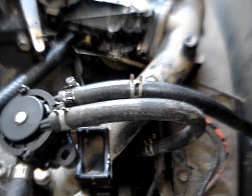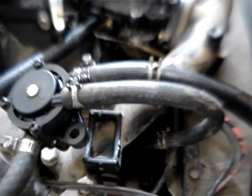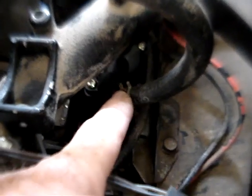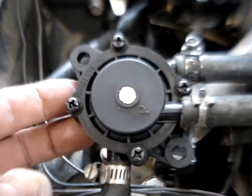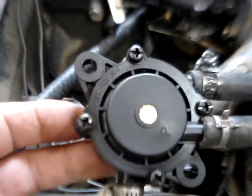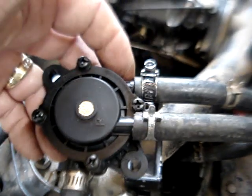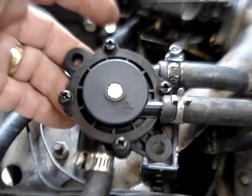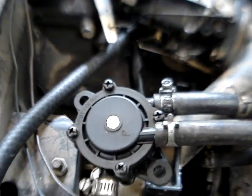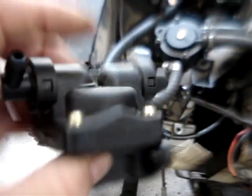All you have to do to convert these over, without drilling any holes in the crankcase, intake manifold, or anywhere else to get a vacuum source, is to use your old mechanical fuel pump that's shot. Just gut it out so it's a hollow cavity, put it back together, reinstall it, and run a vacuum hose out to your pulse pump. This is just an Amazon pump — I'll put the pump number in the description. The biggest thing is to get one with large enough fittings for your 5/16 hoses. You can get rid of these failing Chinese pumps and the non-existent high-dollar Kohler pumps and just run a pulse pump.